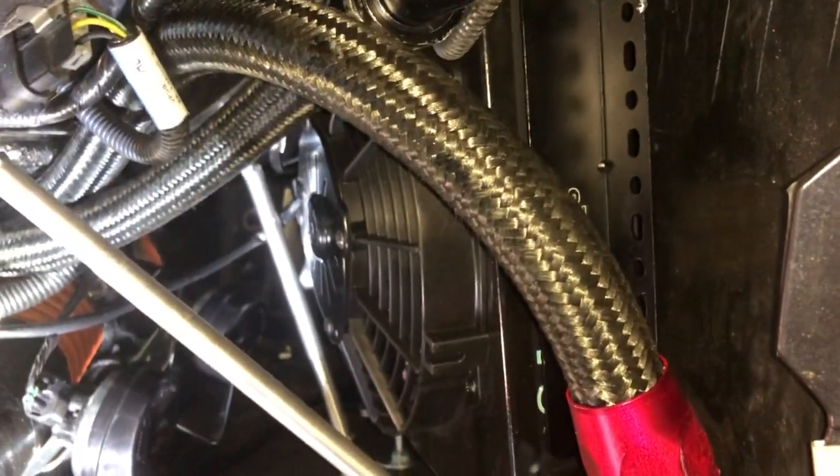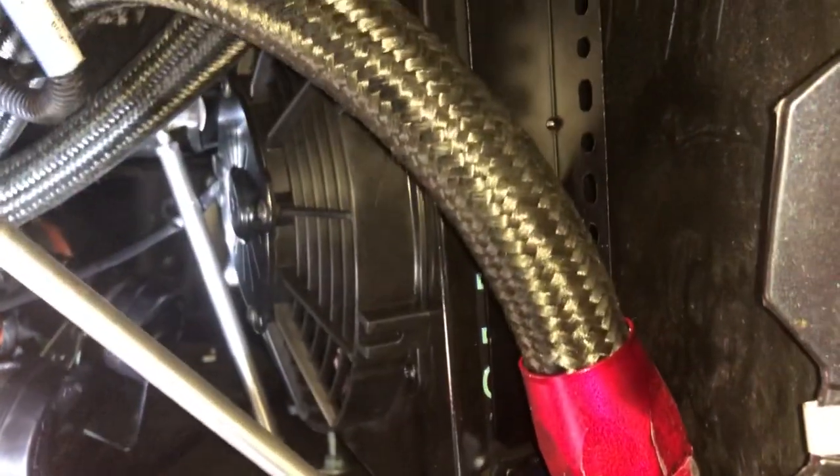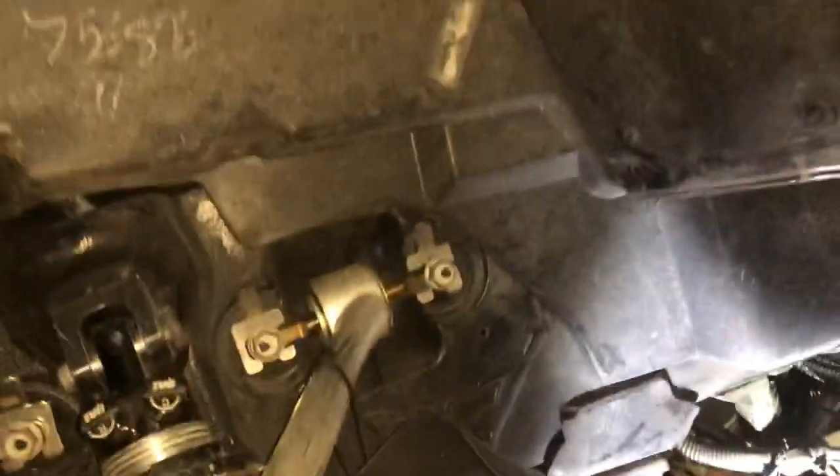So there's what the oil cooler looks like. The transmission cooler is mounted basically the same way. This is the 34 row Series 6. I've got a 25 row on the transmission. I probably could have put a 34 row on the transmission as well and gotten some more cooling, and I may change it out later, but it's okay for now. Again, the transmission was only around 260, so it's more than good enough. But anyway, there's what that looks like for the inquiring mind.